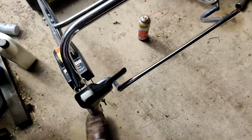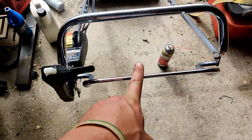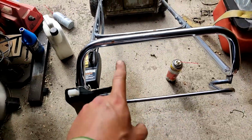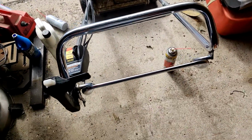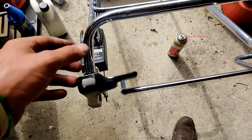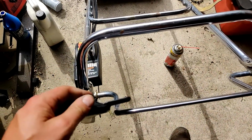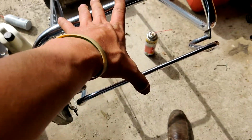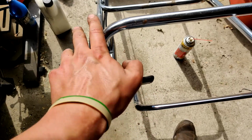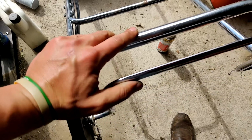So what was happening earlier is I was trying to get the drive to work and it wasn't running. I'm like, this isn't making any sense. Well, this older style Honda, I actually just sold my old Honda, again, previous video, a long time ago. I might be able to find it and link it here in the description. That one was designed so you can run just the drive and not the blades, but this one is designed so you have to engage the blades first, and then you're allowed to turn the drive on and off.